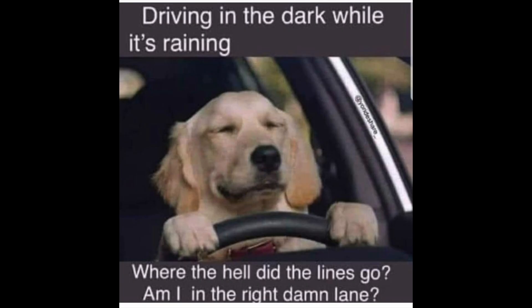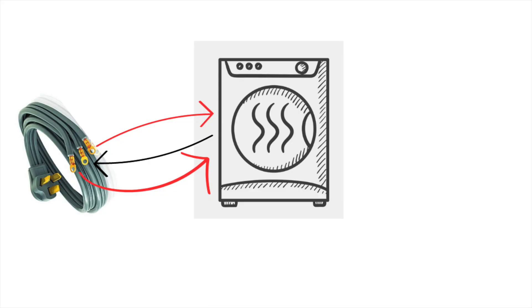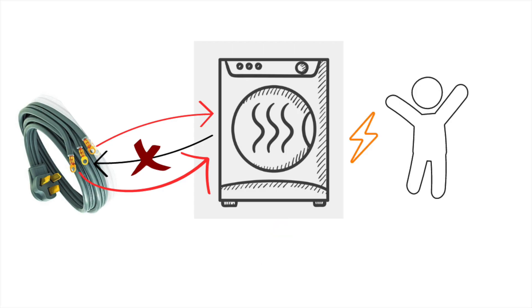How is it unsafe? According to some answers I found, it was a simple matter of redundancy — loose electricity discharging if one of the hot wires broke down inside the dryer, and the neutral wire also happened to break its path back to the circuit breaker. In this case, the chassis of the dryer could become charged without tripping the circuit breaker. If someone came in contact with this electrically charged dryer chassis, they could become a conductor and get electrocuted.